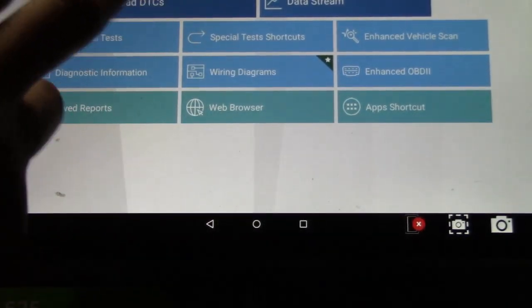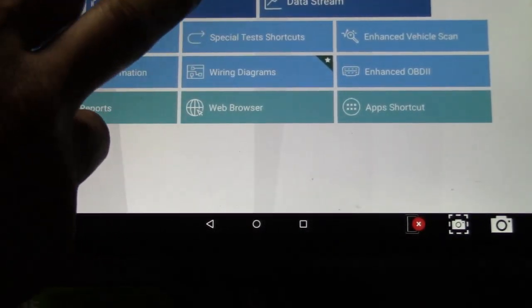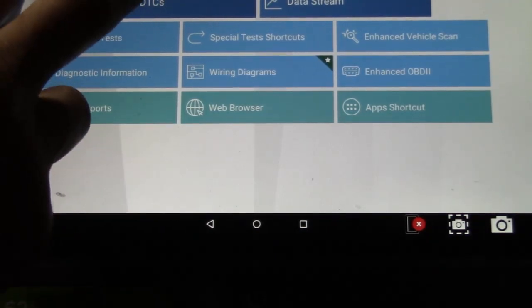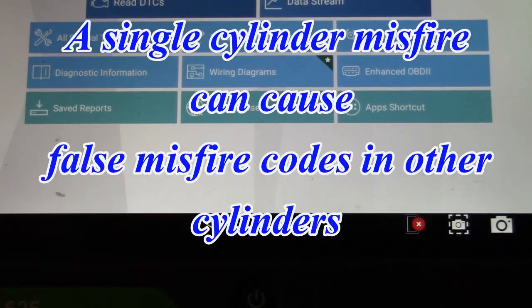So this thing having a misfire, an actual misfire on one cylinder, was causing random misfire codes, as well as, you know, seeing misfires possibly on other cylinders. So the power balance tests led us to one thing. We saw cylinder 8 was the one that was really missing, and it was showing a little on one, which it's not anymore. So always check.